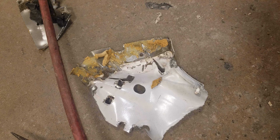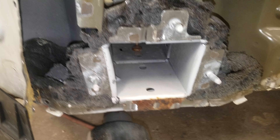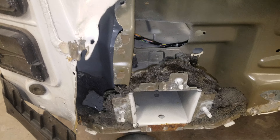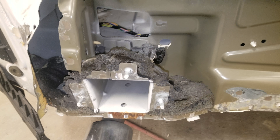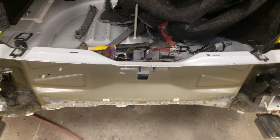You can see the piece that was sandwiched in between. Once you remove all the spot welds, it's like a little jigsaw puzzle, you know — remove all the spot welds and the part, with a little bit of work, will come right out.